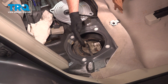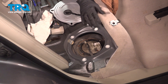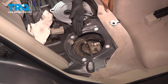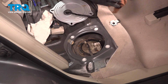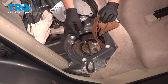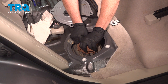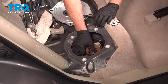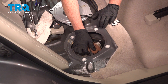There may be some fuel pressure in here. In our case, the vehicle has not been run in a while, so the fuel pressure has been released or at least depressurized quite a bit. If you're replacing these components, your vehicle is probably not running, so the fuel system is probably depressurized — but you can never be too safe. Use a rag, safety gloves, and safety glasses. Pinch the tabs and pull the hose off. We do have a little bit of fuel leakage, so use a rag to absorb any released pressure.